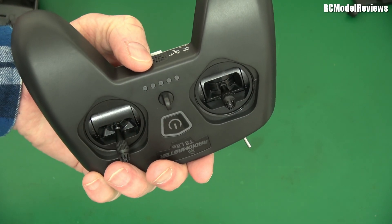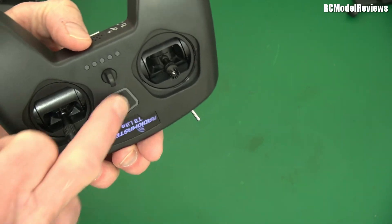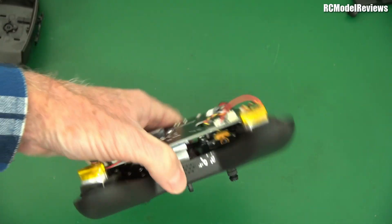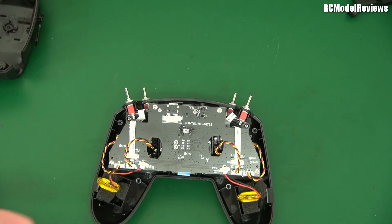Keep at least two or three of those bars illuminated if you're going to store it for any length of time, and check it from time to time. This has a soft power button, which means there's always a certain amount of what we call parasitic drain on the battery. So if you leave it for a long time, it may actually drain the batteries even though you charged it to a reasonable state before putting it in the drawer.